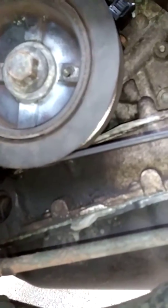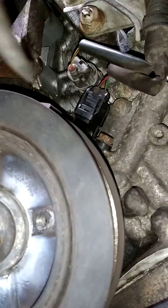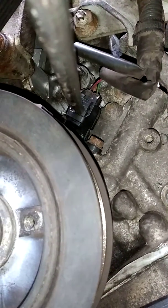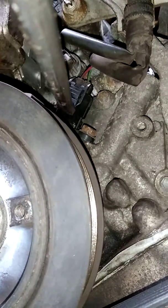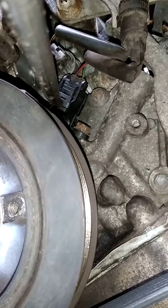Here you can see the wire, but I'm going to go to the side because this is easy to locate. I tried looking online and couldn't find it for the RX-330. Right there is the crankshaft sensor — right here. So if you have a no-start, turn the ignition on and there's no start — it doesn't even crank over — it's usually here. This is the crankshaft sensor, because the crankshaft sensor will not let you turn over the car at all.